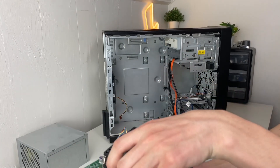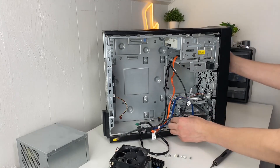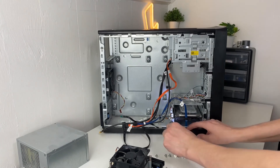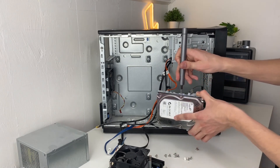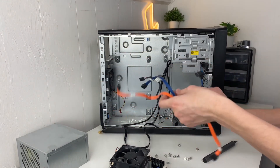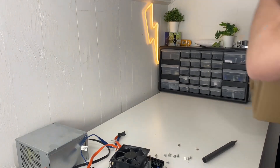You don't want to break it or anything — you can just set it right there. Next, if your pre-built system came with a hard drive or any drive, go ahead and take that out right now. Detach it from the drive cage and take all your SATA data cables out so you have some extras. That's all you need from the old build.